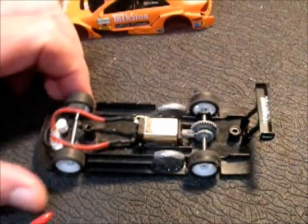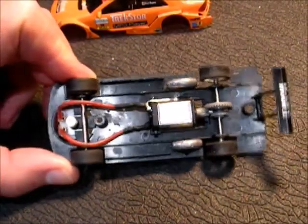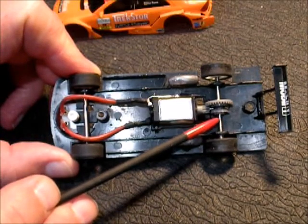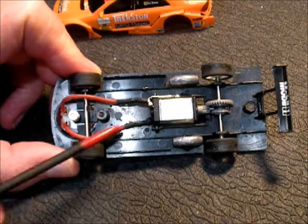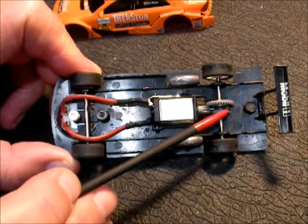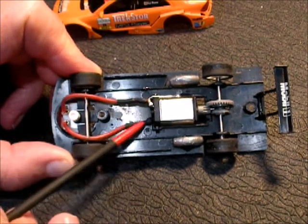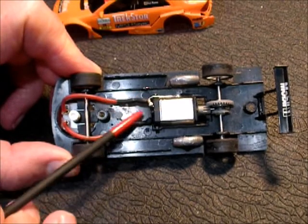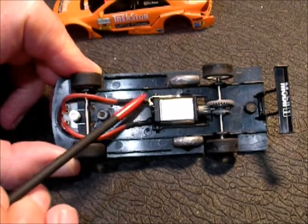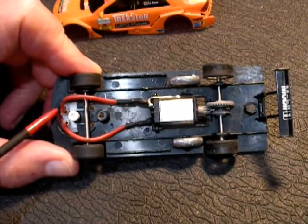Okay, take the body off. See modifications to the inside. As you can see, this is highly modified compared to the standard car. First thing is we have 3/32 drill blank axles, custom made. Alright, and we've got silicone wiring with some special sleeves soldered and heat shrunk on. This is the Peter Pfister guide again. Okay,